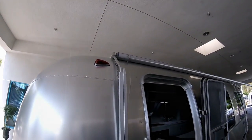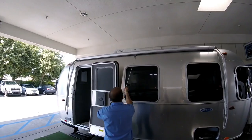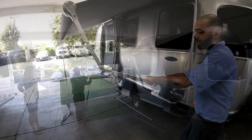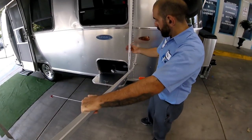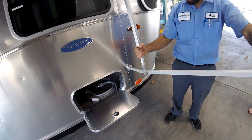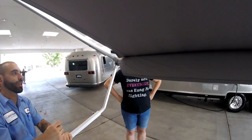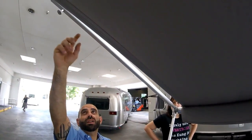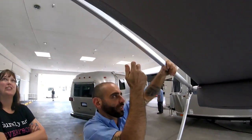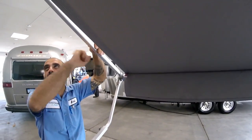When you want to use the awning, have one hand on it so it doesn't snap back. This is the locking arm that holds the awning down — it has a home but it's not locked in; that needs to be free. Take it out and place it in the only spot it can go. You need to lock this piece — it has a large spring inside. Hold on to it close for more control. The further away you are, the more it wobbles.